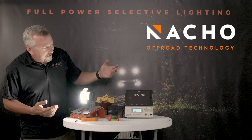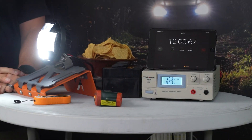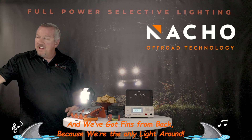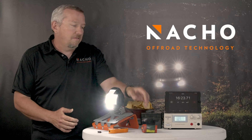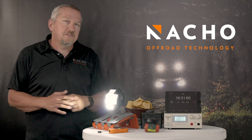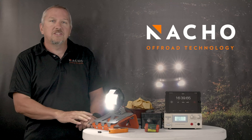Okay, we're back. Took about three minutes at eight miles an hour and the lights are back at a hundred percent. A lot of that's the thermal design of the housing — you've got fins from the front so it's gonna capture all that air flowing from the front. If I turn the fan off, it's gonna be about the same thing. Now that the lights have cooled off, we're sitting right about 120 degrees. LEDs are happy, LEDs are running cool. The Nacho thermal management system is going to keep it at full power as long as it can and then it'll start ramping it down nice and smooth.